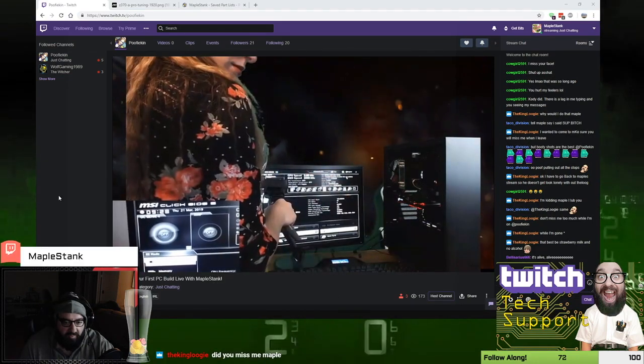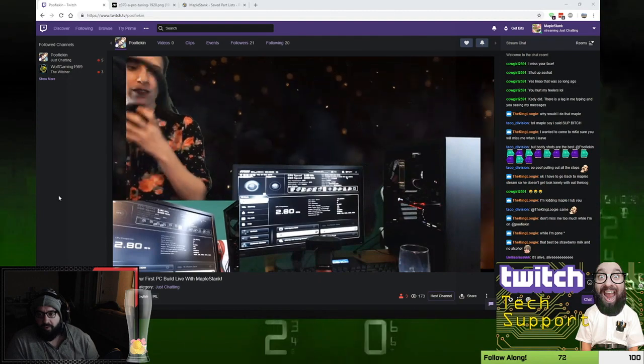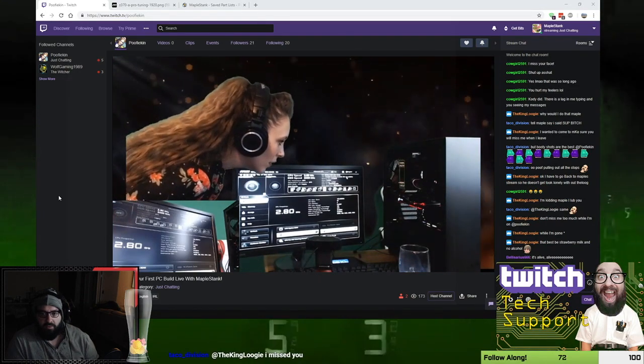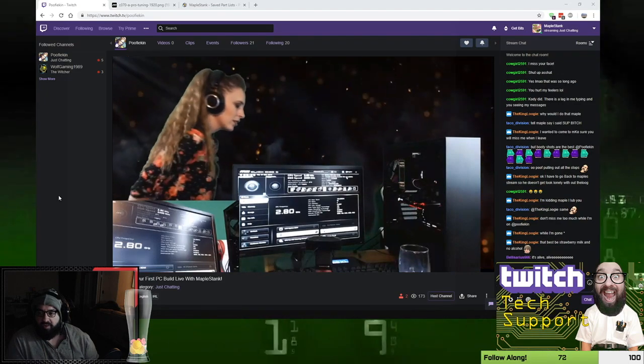So the first thing is the date and time. So that looks like it's 1 hour ahead, right? I want to make sure that all those fans are spinning, first of all. The back one looks fine, but what about the top one? And the one on the CPU is spinning as well, it looks like from here. The cooler block. Yep. And the graphics card may or may not be spinning yet, because usually it has to heat up for it to spin.